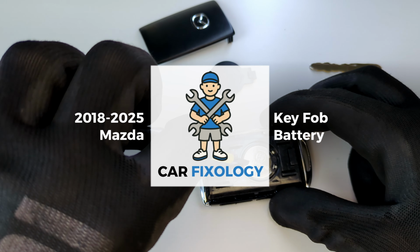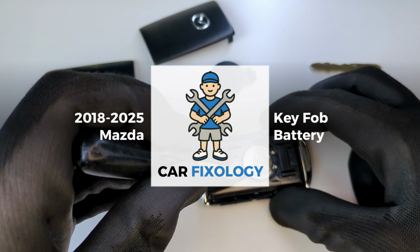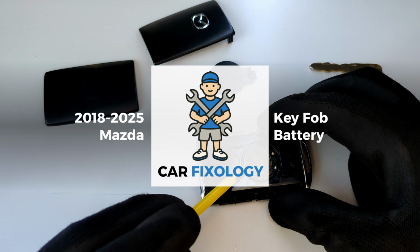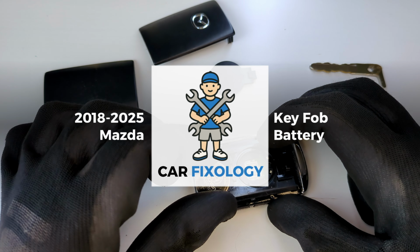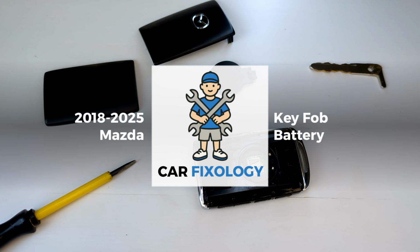Today, I'll show you how to replace the battery in a Mazda key fob covering most models from 2018 to 2025. It's quick, easy, and you can do it right at home. All you need is a small flathead screwdriver and a new CR2032 battery.